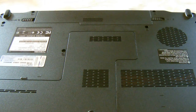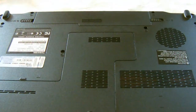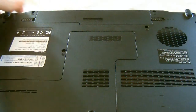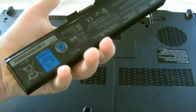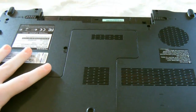To install more RAM, the first thing you want to do is take out the battery. You just want to hold that back because that's like the spring lock. Keep it out like that, and in my case it just slides out backwards. Now you can start working on your laptop.